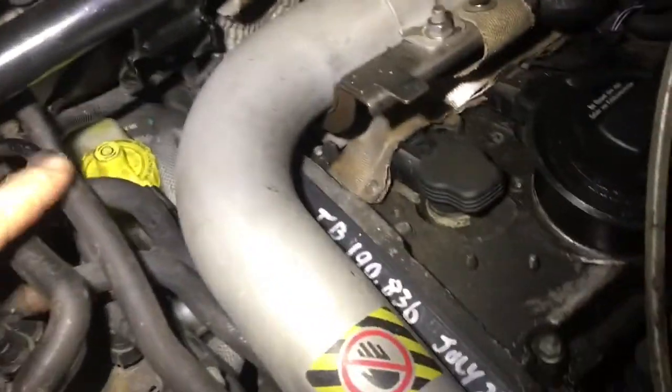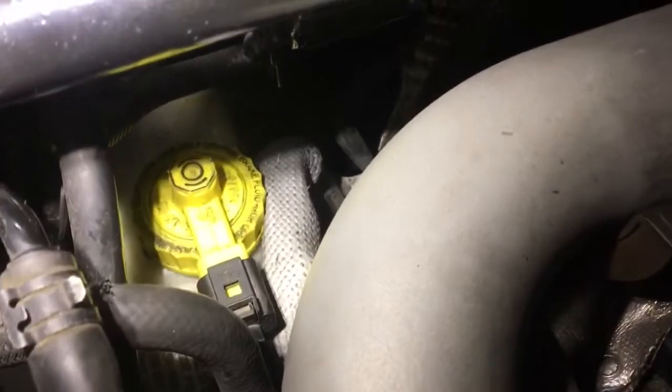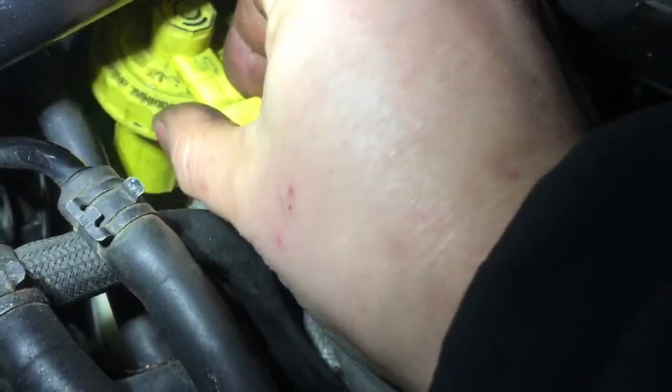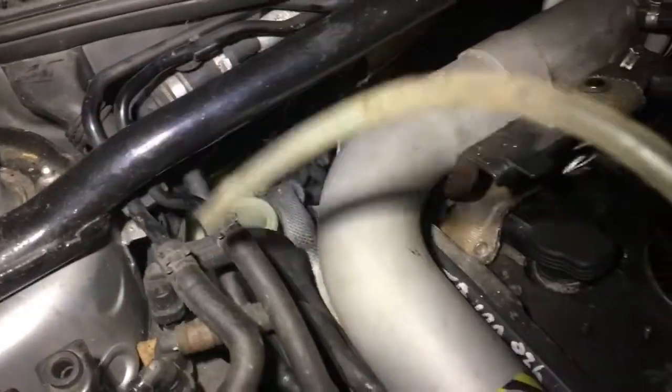Along with changing all the seals and the brakes, we're also going to change all the brake fluid. There's no point putting the same fluid back into the system so we're going to totally drain it without letting any air in. We locate the brake reservoir just down here, take off the little black clip — on VW/Audi you push the entire clip in, push down on the little tab and pull back, and the whole plug opens off. Then we wind out the cap. Next, get a piece of pipe — the anti-roll bar is in the way — and an old syringe to create a vacuum on the pipe to suck all the dirty fluid out of the reservoir and replace it with new fluid.